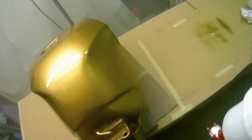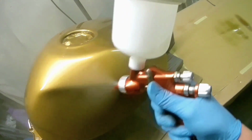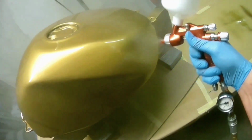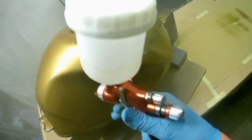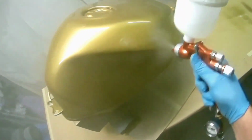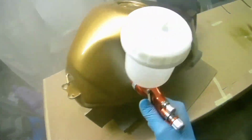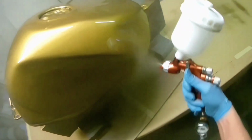So you need normally a 415 or a 3-phase electrical system, although what I do is I actually run two in tandem. So they're both 240 volt and they run on a separate electrical supply, so they can both run together. But yeah, it draws a lot of air, it uses a lot of air, so that's my main criticism. So at the time when I was doing the top 12 video, I was looking at this gun, and that was a real negative that stuck in my head.